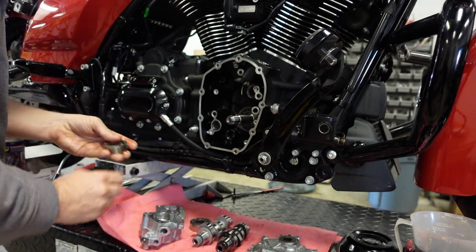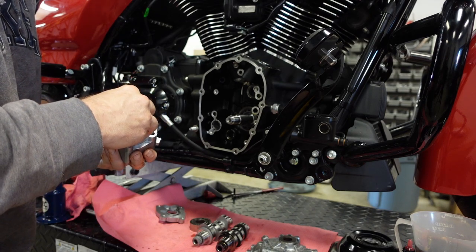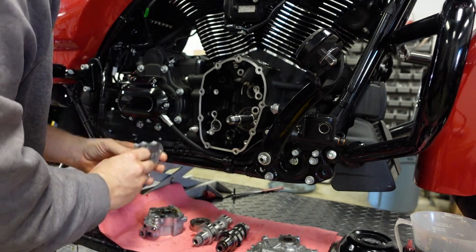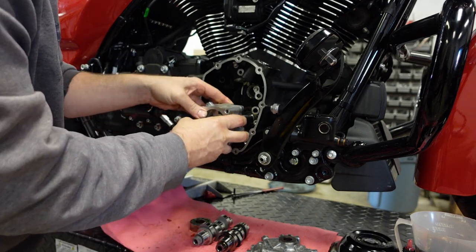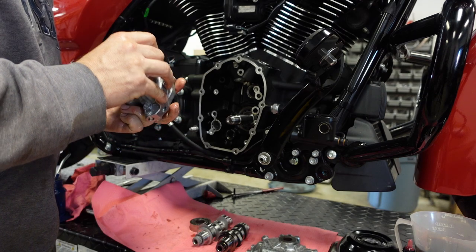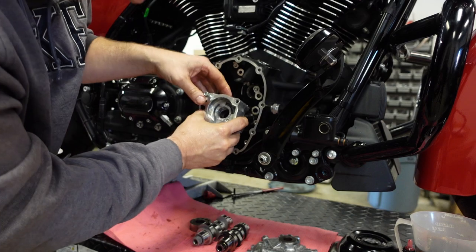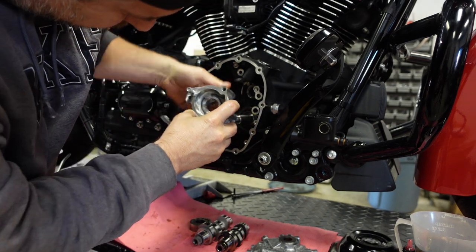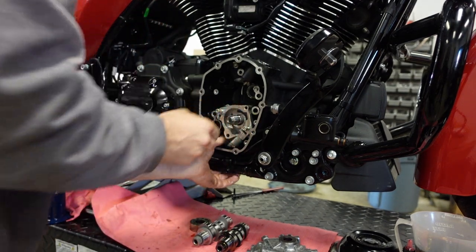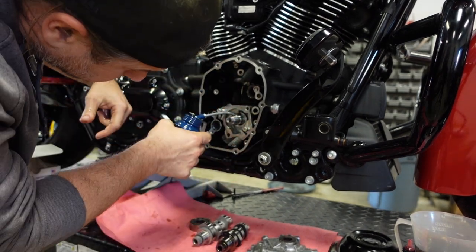This is the factory OEM oil pump, so we're going to use engine oil on the rotors and the pump body. Make sure the rotor gets installed completely and the seal on the back of the oil pump is installed. We try to clock the oil pump gears to the pinion shaft to make installation easier. I usually stick two screws through the oil pump body onto the backing plate to keep everything lined up as we install this. Once the oil pump and pinion are lined up, push the oil pump into the o-ring — it should snap in and be fairly snug. It shouldn't be hard to get it in there at all.